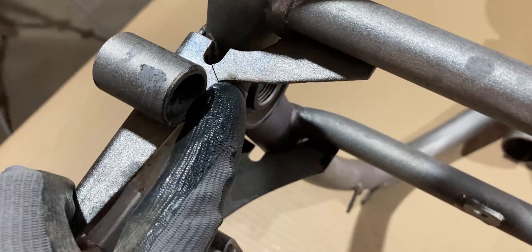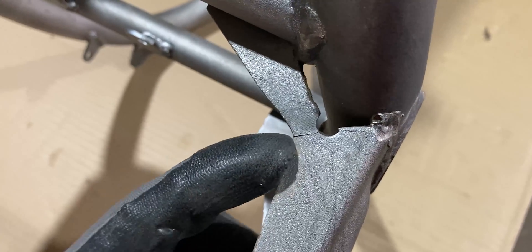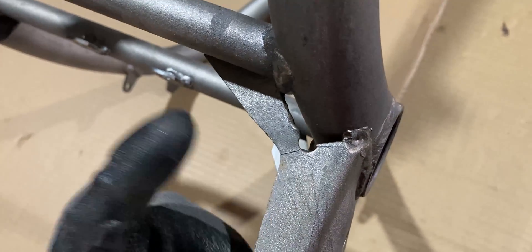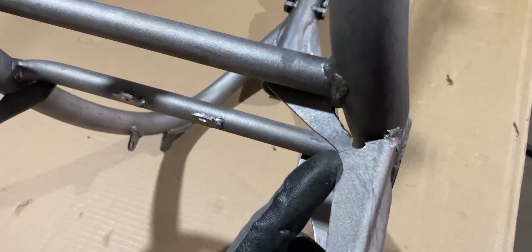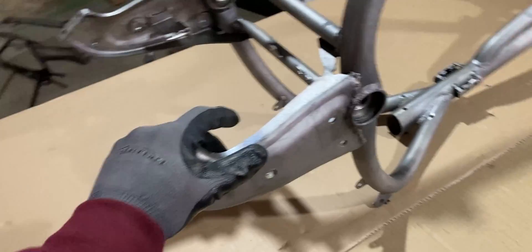Towards the back on this side, I noticed a crack on this crossmember or support bracket, and right here as well. We have a crack and I don't know if this is a flaw or if it happens to almost all the frames, but I'm going to have to fix that. I'm glad I cleaned this up because I would not have seen it otherwise. If this is only welded to one side of the frame, that's not good — you need strength from left to right, and if there's a crack there it's possible the weld on the outside will suffer as well. I'll have to fix that before applying any primer and go through all the welds to make sure they're still in good condition.